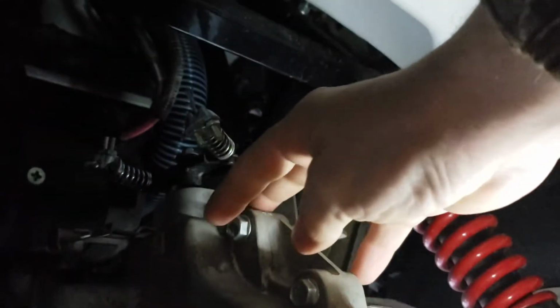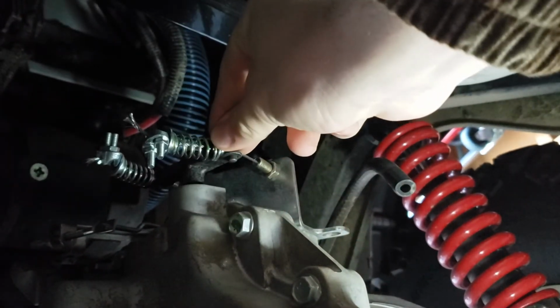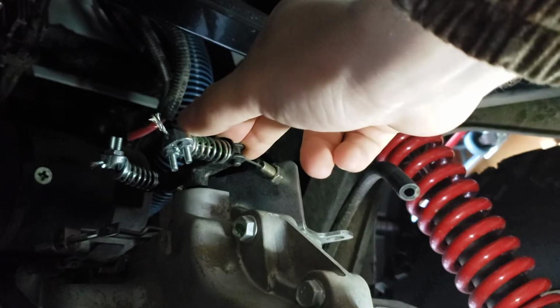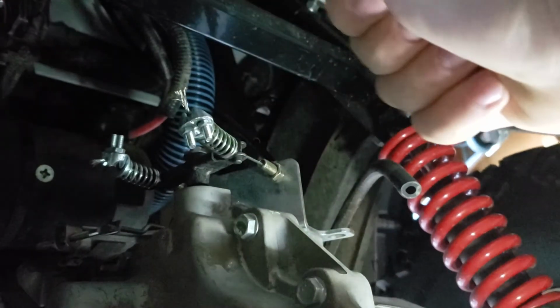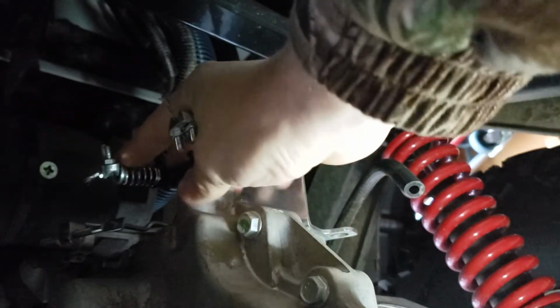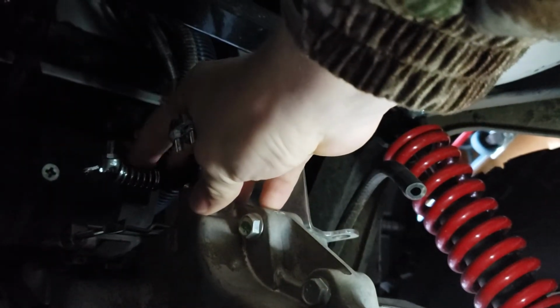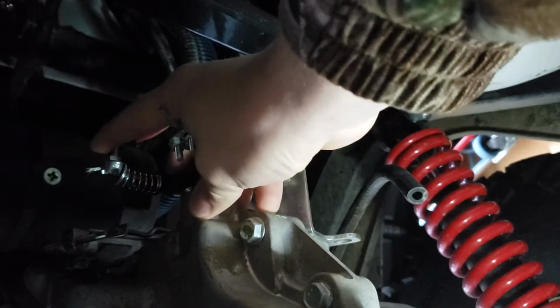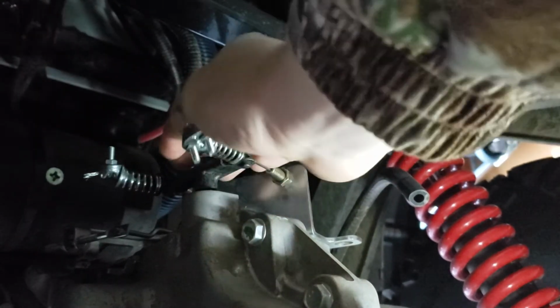After that, once you get this all assembled here, you do have to spend some time tuning it, figuring out where to set these clamps so that you have enough to completely put the shifter in each position and make sure that the T-bar is in the correct position. So when it's in forward, this should be positively engaged with the spring compressed and still have a little room to pull it even more. When it's in forward or reverse, I do not want to see these 100% compressed. That just means that I'm over pulling the cable.